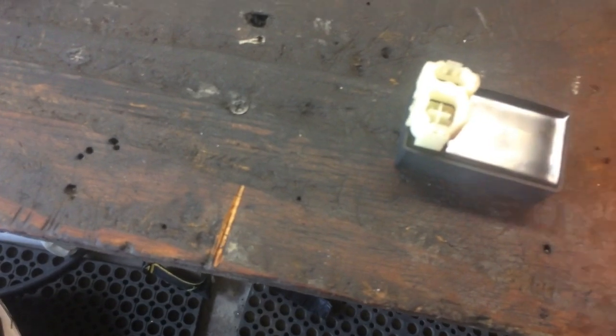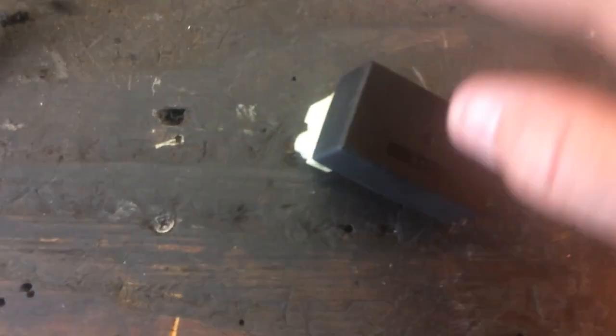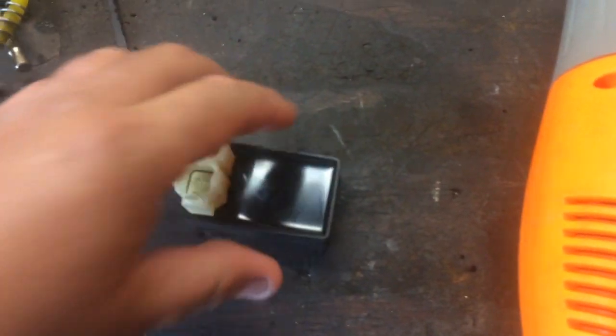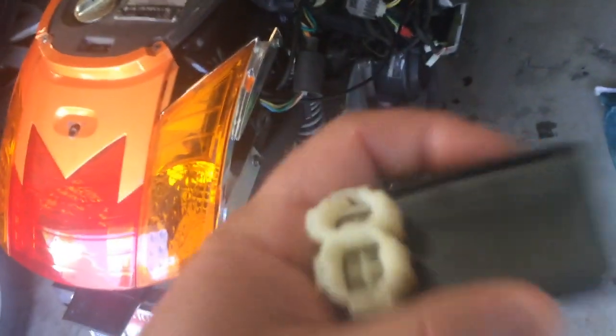With this Chicago Electric heat gun, just sit right here close to the silicone and keep heating it. You don't want to melt the plug, but get it really hot. Turn it on its side, heat that side, then turn it upside down and heat the bottom — this all helps. You'll know it's hot enough when you don't want to pick it up with your bare hands. Put on a pair of gloves, carry it back to your scooter, plug it in, and see if it starts. Nine times out of ten, heating it up good and hot will get it working again.